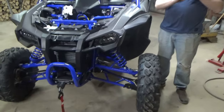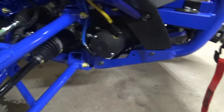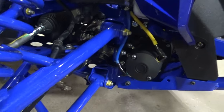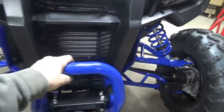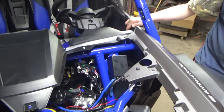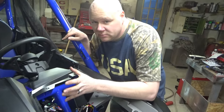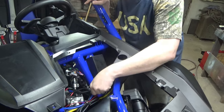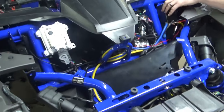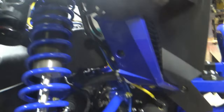So what did we do in that six hours? We did our winch mount, our winch install, our winch wiring. The winch is a Super ATV 4500-pound winch with synthetic rope and a Super ATV winch mount. The bolts in the back of the winch took probably an hour and a half just to get the four bolts in — it was a tough one. For the winch wiring, we took the positive and negative that Honda already had wired into the unit, ran that to our winch box. The winch wires — positive and negative — that Super ATV includes, we ran off the solenoid, did a little service bundle, down the tubes, down to the bottom, onto the winch.